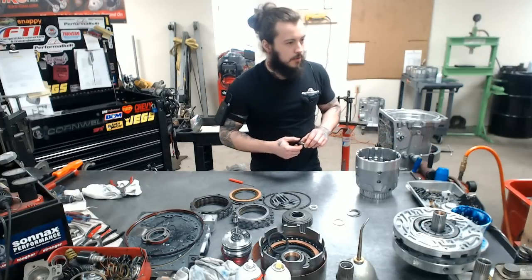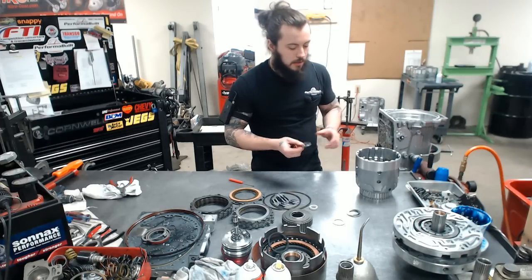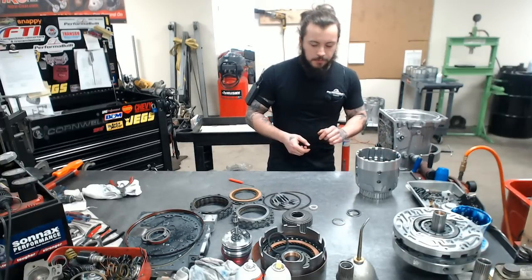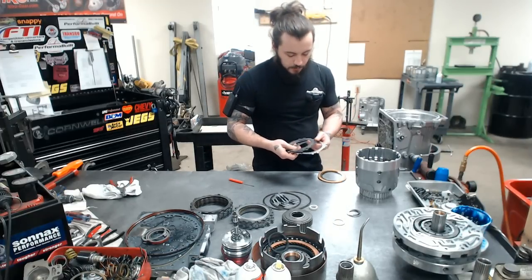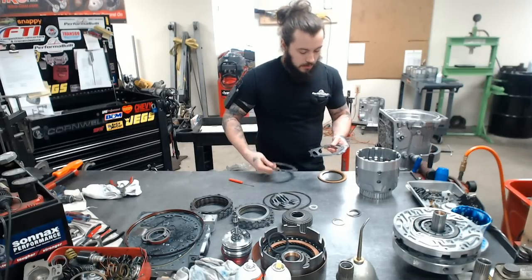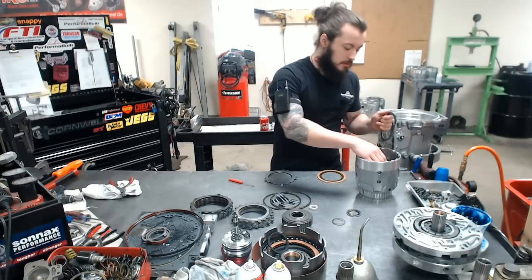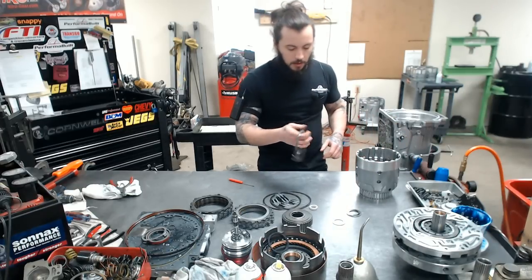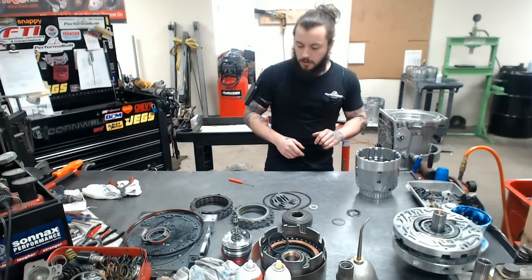I'm going to start layering the clutches. Lots of little parts like I explained previously. Let's put them in first, that way we don't forget about them. That's your Sprag bearing. And after that's in, got some good looking overrun steels here. So we're going to start on the very bottom with the steel, overrun clutch steel, overrun clutch, and the apply plate.